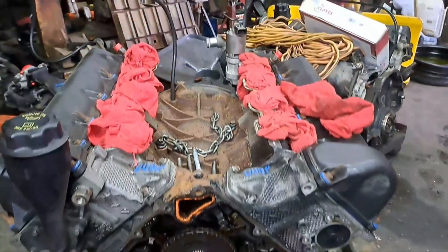We've got both sides directly at 12 o'clock. I rotated the engine a full 360 degrees and got those marks to line back up right there - you can see them. I made a couple of marks right here and right there so I could put everything back and double-check. I left the guides out enough to fumble the chain around and get it where it needed to be. On this side I've already pulled the bolt out, cleaned the hole with brake cleaner and an air hose to remove oily residue, then put a little bit of Loctite on the bolt - that helps it hold.